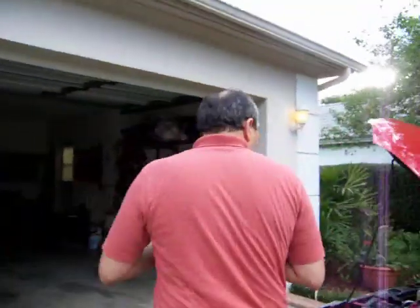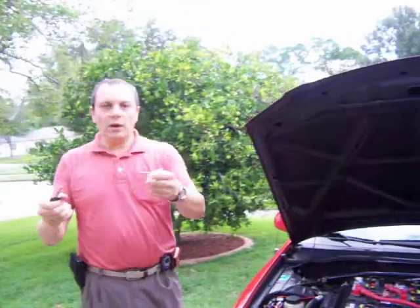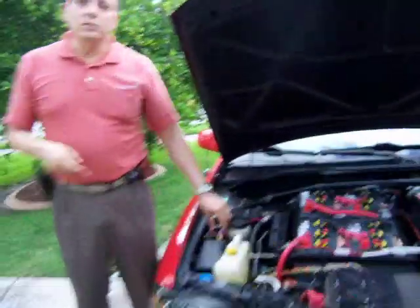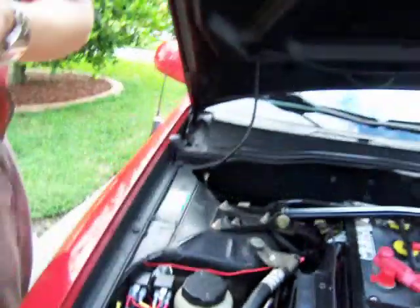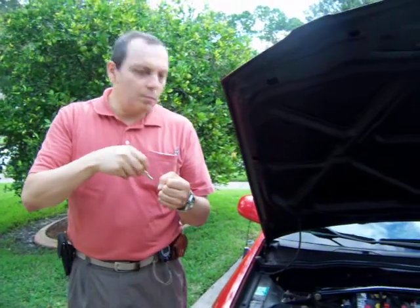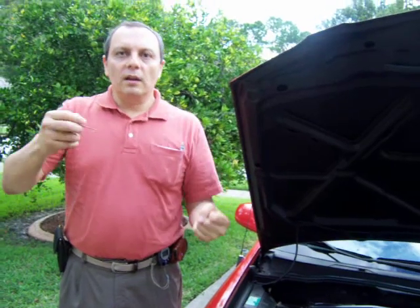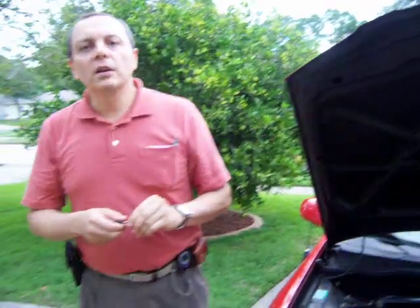One final thought: my power steering is always a bit jerky when it starts — it starts at full power. So when I'm driving and the power steering suddenly turns on, it's sometimes a little jerky. I'm going to try to install the capacitors also in parallel with the power steering, so that when the capacitor is charging it should absorb some of the power going to the power steering pump and I should get a much smoother pressure when the pump turns on — a little less jerky start. I think that's it, that's what I have for now. Thank you for watching.